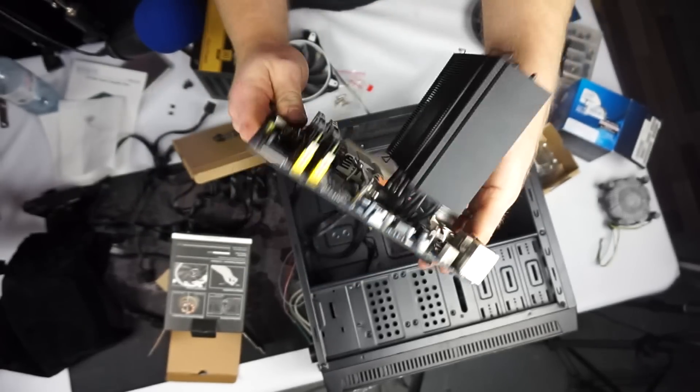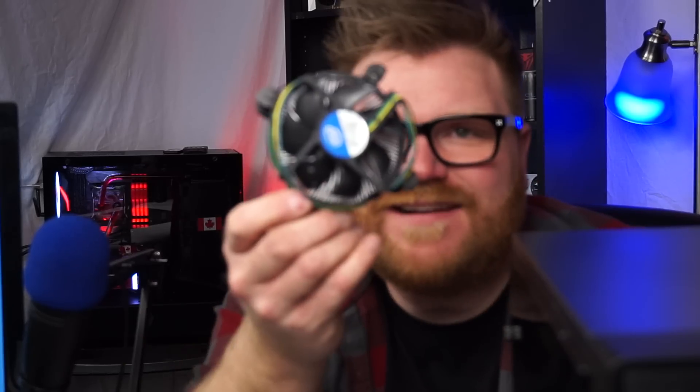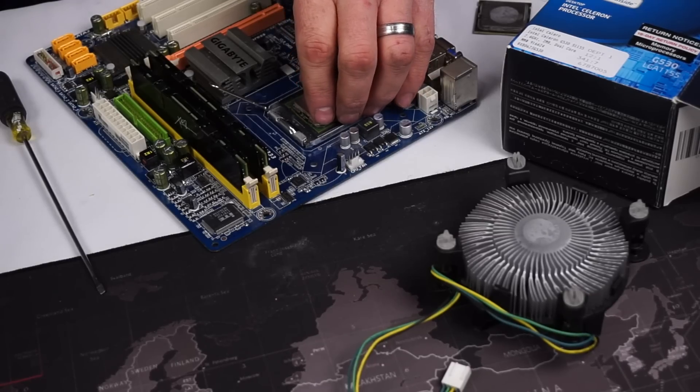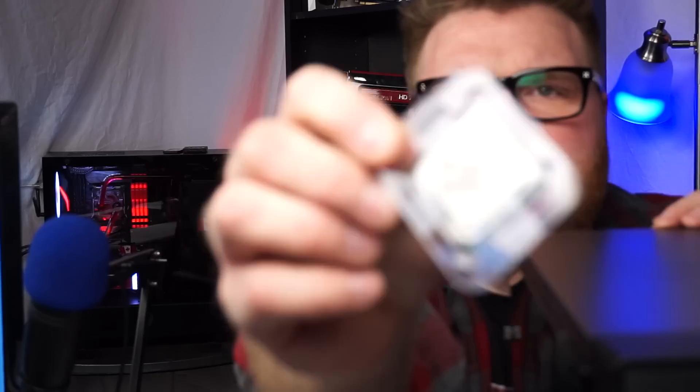I had to put a pretty nice tower cooler on it because this thing was giving me all kinds of trouble. When I first started this and had the system going with the stock cooler on it — total joke. I was having so many problems for like a day trying to get this thing going. I thought maybe the processor was screwed up, since someone had sent it to me and I wasn't sure if it was working. Turns out the TDP on it is way too high for that crappy stock Intel cooler — the only cooler I had for Socket 775. So I jimmy-rigged a nice Arctic one on instead.